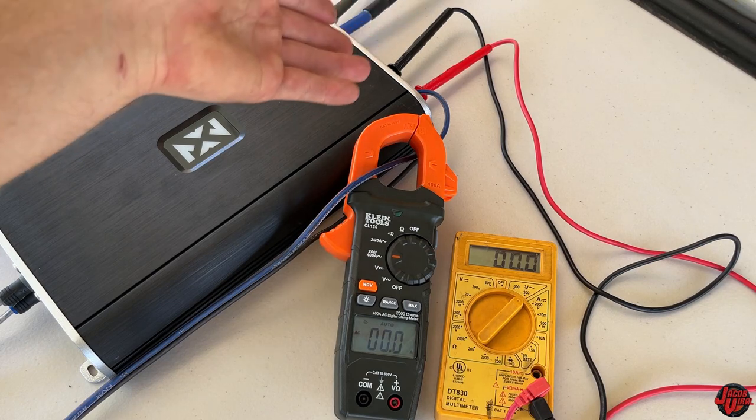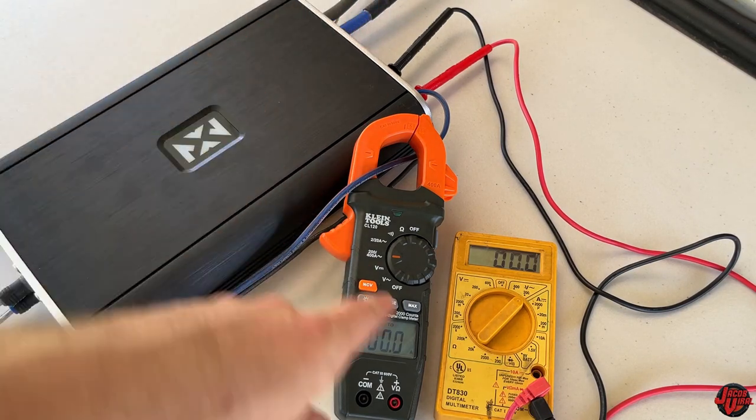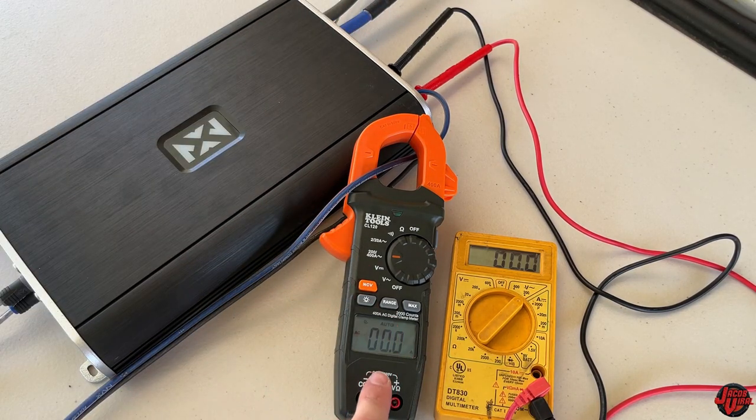So it's starting out at 4 ohm or 3.7 from the coils of the sub, and then we're going to see how much rise we get as well as how much power we're putting out to the subwoofer. I'm going to be testing on a burp setup, and then I'll play some extra bonuses if y'all want to see how much it plays on music as it changes. So here we go. Got everything set up. We're going to see how much power it's putting out.